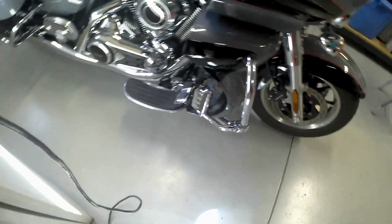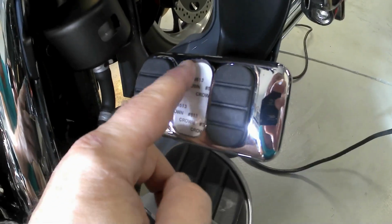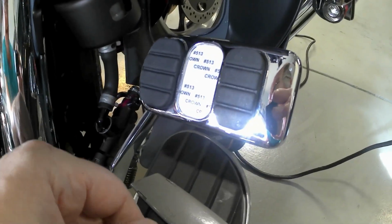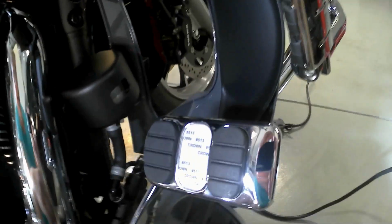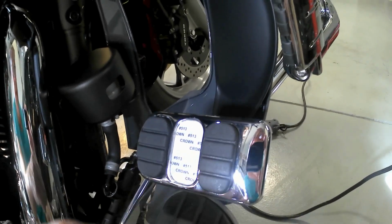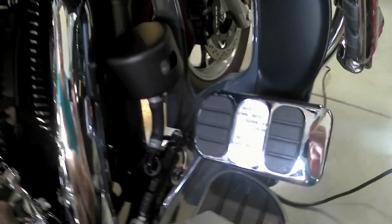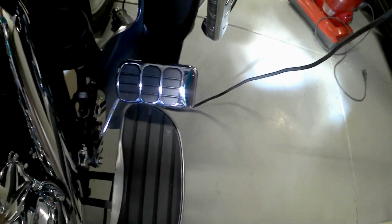Okay, so now let's get the pad on. Use the heat gun just to go ahead and get it warm. Not hot, just warm, so that this will basically stick. I'll go ahead and peel this off, put the pad on, and then I'll go ahead and get the clamps on there like I did this one here. And that way, you can go ahead and really set up a good bond, and then I'll be done. That's it. Still need to put the clamps on, but just wanted you guys to have a look. That is the finished brake pedal.